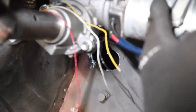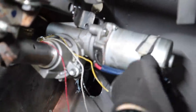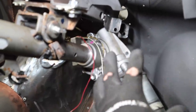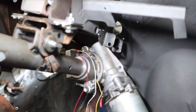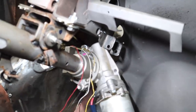I made the mounts at the back to mount on the electric motor for the power steering, and I actually put some rubber bushes in between — that was a bad idea because as soon as I did it this thing just moved all over the place each time I turn the wheel. So I'm going to have to cut these out and just put some washers in there and have it hard mounted. There's no way to avoid it. I was trying to make it a little bit softer, but this motor is going to be moving the power steering and it has to be rock solid to the car.